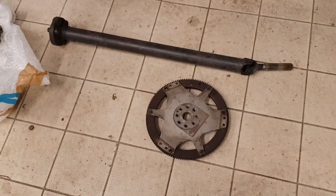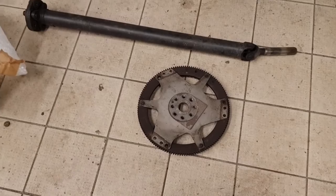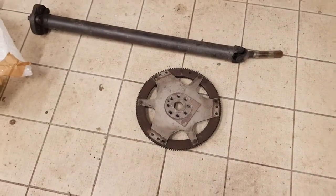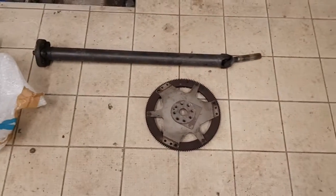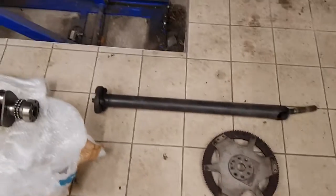The problem on these cars is that the prop shaft can move within the clamp, and when it does that it puts force onto the end of the engine. I'll quickly explain the situation inside the engine so you can see that.